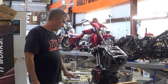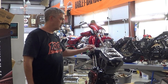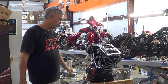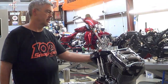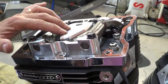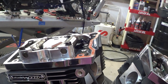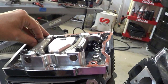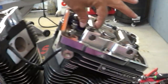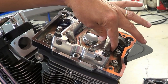Now, one of the purposes of this video is to talk about our billet rocker stands, S&S forged roller rockers, our billet breathers and how all this stuff works. So if we bring the camera over here, we can actually see some stuff. This is our billet rocker stand, this is our billet breather, and this is a set of forged S&S roller rockers. In the rear cylinder, I've already got the pushrods in and adjusted. Everything in here is nice and tight, but it moves freely. There's no play side to side, but up and down it's like a Rolex.